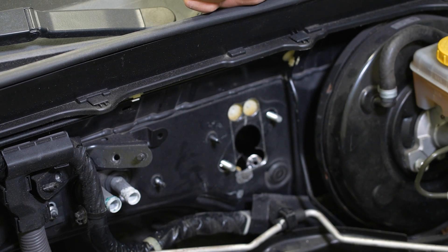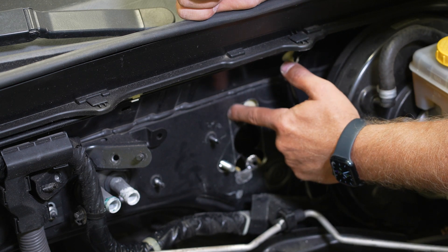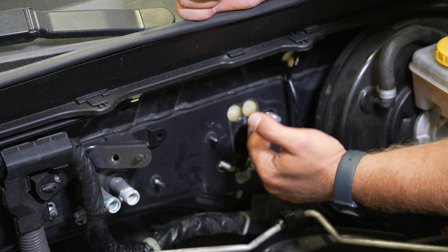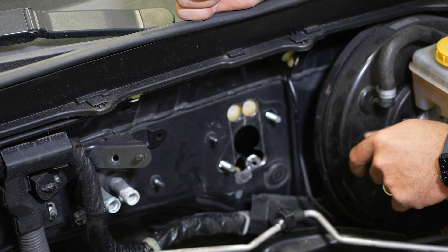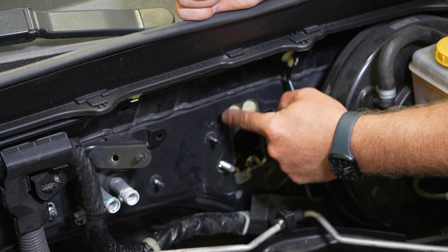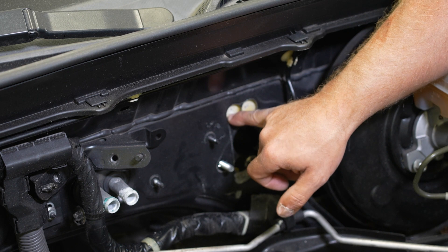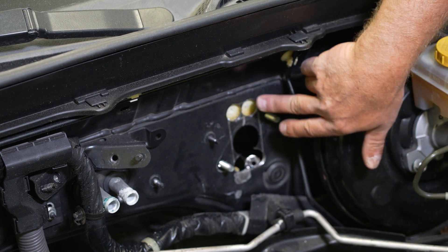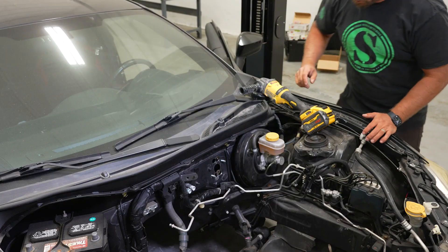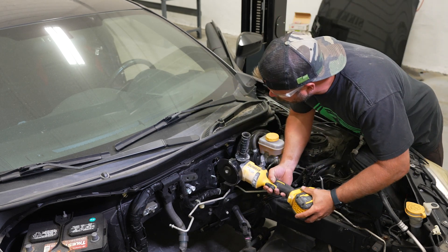All right, four holes cut — now to connect the dots. Now you can do this before or at this stage like I am right now, but you can see there's all this foam on the inside. It's not really going to get in your way, but it can kind of gum up your blade and it's mostly up on the top side here. So I'm going to go inside with a razor blade and just cut out a little bit of a window around this. I'm not going to film it because it's impossible to get a camera and light up in there, but we're going to get this foam out of the way and then come in here and cut the rest out. I'm going to opt for the cutoff wheel method — I just feel like I can maintain a little more control in the placement of my line.